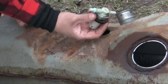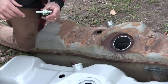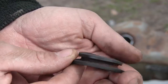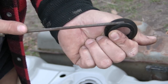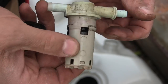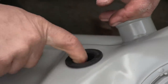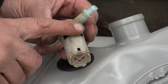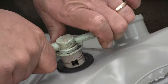On this particular tank, there's a breather hose unit that came out of the old tank and did not come with the new one, so we're just going to swap this part over. The rubber grommet from the old tank we'll reuse, but there's a bunch of rust in the groove where it goes into the tank. We're going to use a chainsaw file to clean that groove out and get all those rust particles out. Here's that little breather assembly — it's kind of like a PCV valve. We'll install our grommet, put a touch of oil on the housing, and that's going to help it slide into the grommet much better.